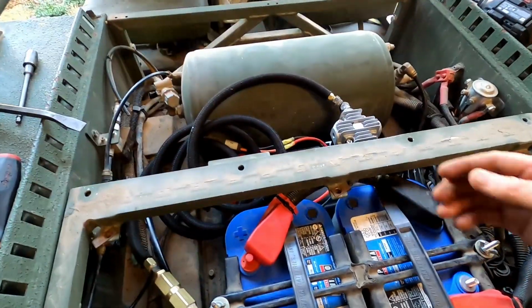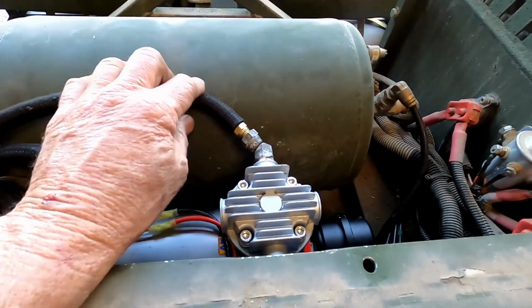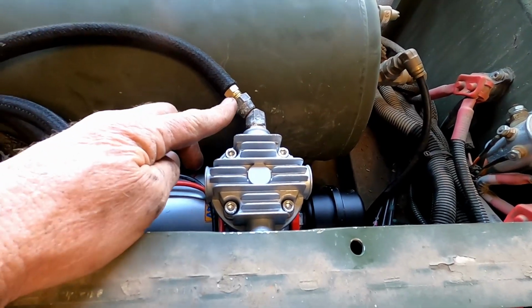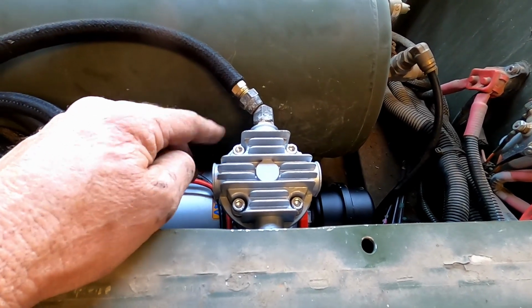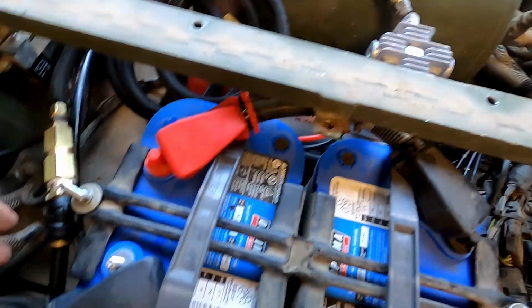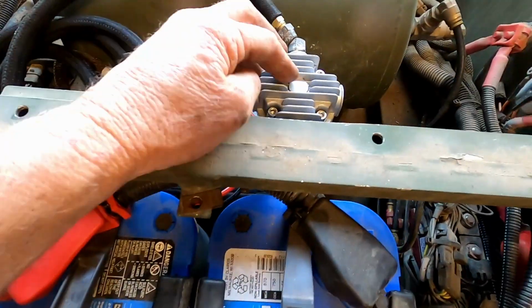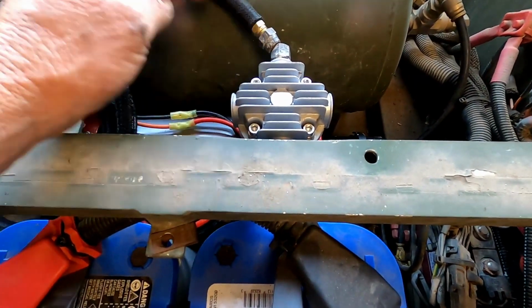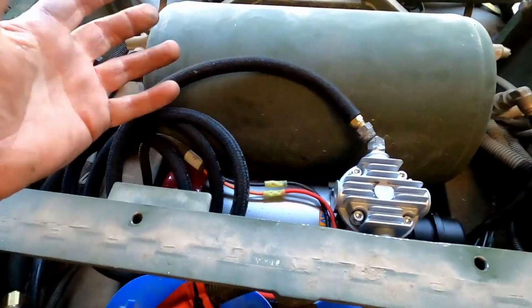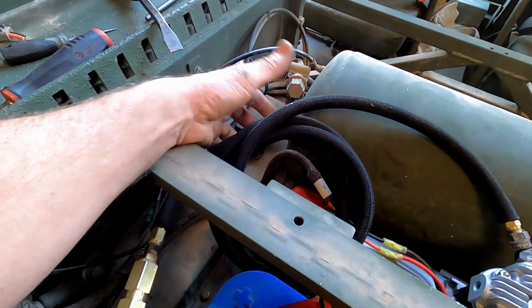All right, so I've got the electrical connected. I ran the air line. This is that 6 foot air line. I just put a 45 here. I couldn't find a 90-degree elbow, but a 45 is better anyways. There's less restriction. It's odd that the truck was built with 1/2" hose, but I guess that's just how Growler did it. With the compressor, they gave you 1/4" fittings and 3/8 hose. Sorry about the camera angle there. But so I just wrapped up their 6 feet of hose like that.